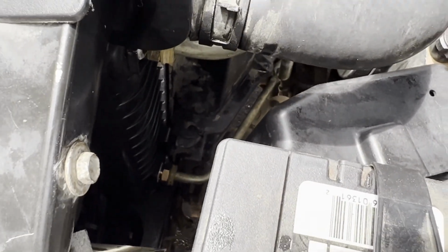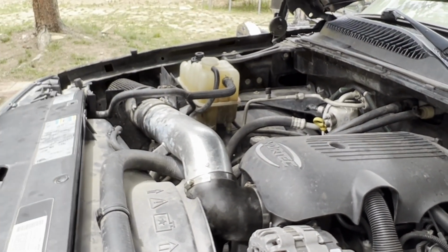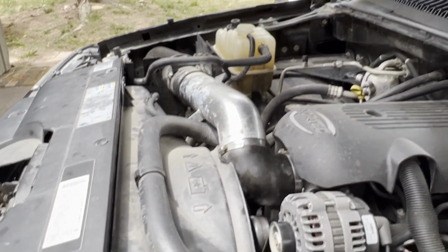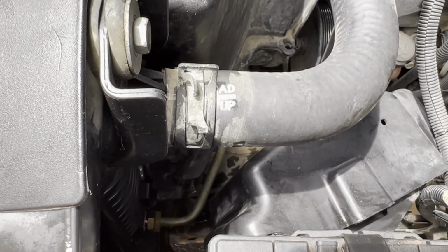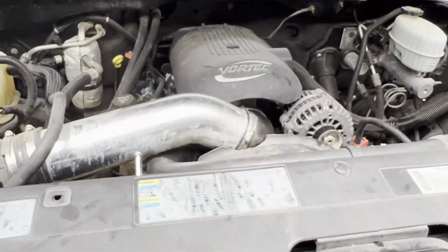And now she is ready for me to start dumping that expensive antifreeze in there and fire it up and try to get the air to go all out of the system. And of course, I didn't add this earlier, but one of the most important things you do when you go to put this thing in, make sure your petcock is tight. That way you don't dump fluid all over the place.